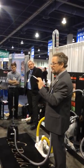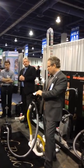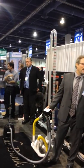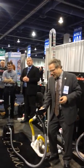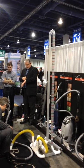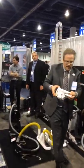They lose airflow through the filters that all the air has to go through. This is just the primary filter on the back end of the Dyson, for instance — and all of them use the same design. The primary filter that's supposed to capture all the dirt and debris is foam. They can call it HEPA media or HEPA type, and technically it is. When we look at the bag system on this one here, we can see that it's HEPA material.